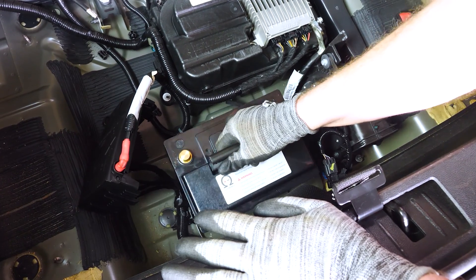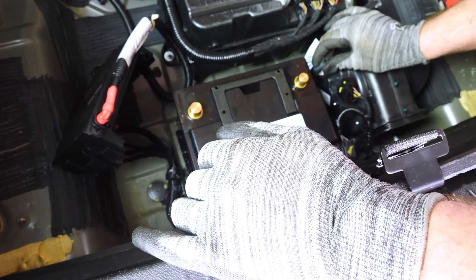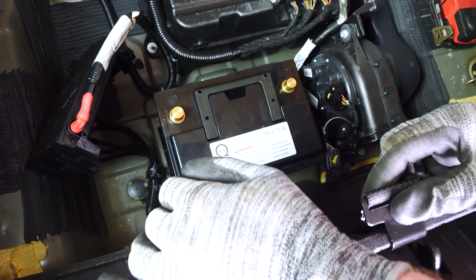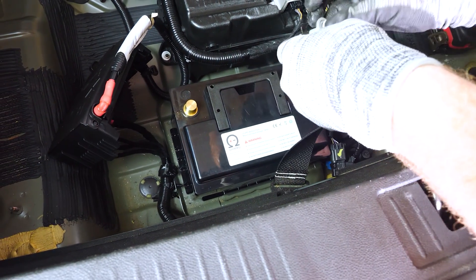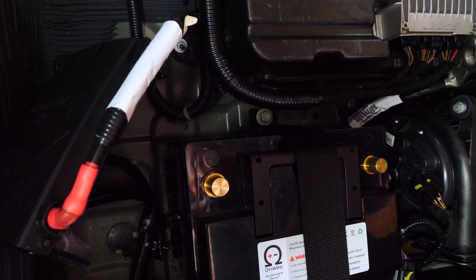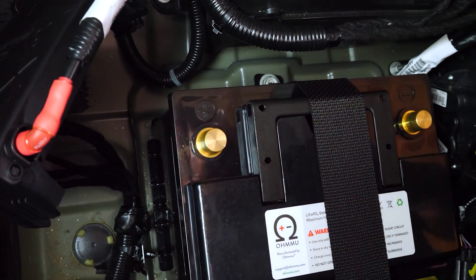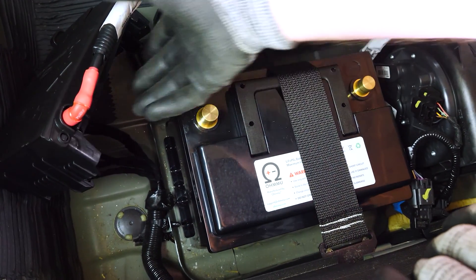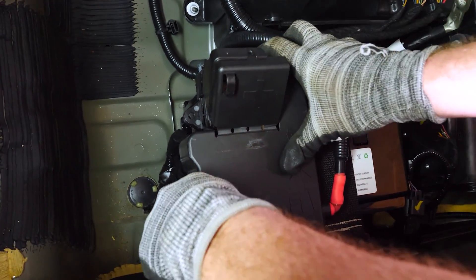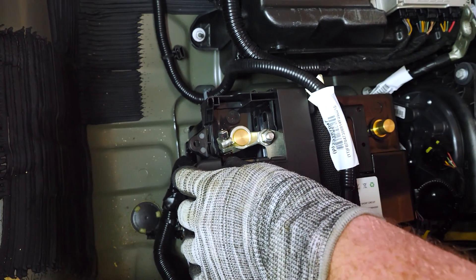Let's bring this battery back in and put it in the same way. There is a vent tube — we didn't remove it on the old battery — but you just detach it and let it rest down here. It's no longer needed because these batteries don't off-gas at all, so you won't need to reattach that vent tube to anything. Go ahead and secure the battery first, putting the tie-down strap down until it holds the battery nice and snug. Then we'll reattach the positive first — line it up, slide it down, click the top case on, wiggle it to confirm it's firm, then switch to a 10-millimeter and tighten that.